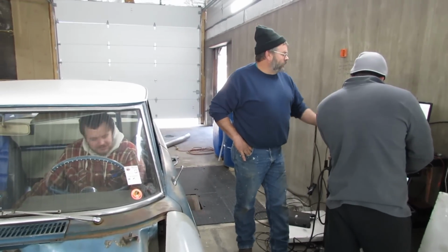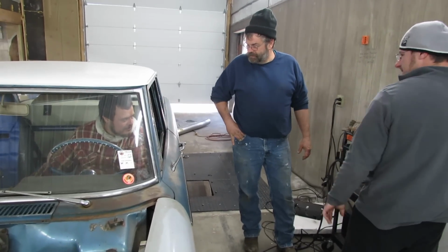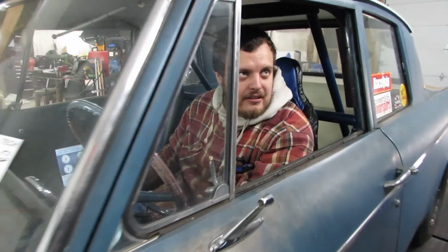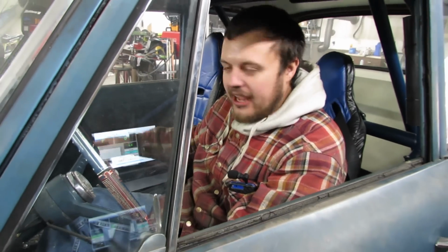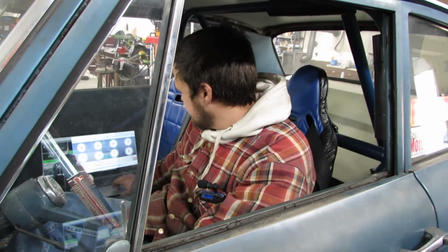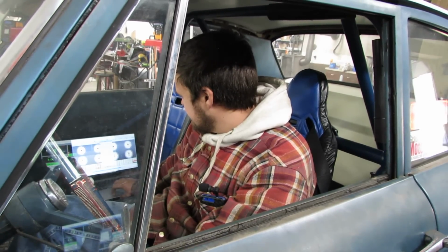All right, so I trimmed some fuel down low out of it. And I'm throwing 23.7. That's the noise you hear. Is that polluted? Yeah, it's too much fuel. The AFR gauge goes 10. Well, actually, not to be argumentative, but it's actually not too much fuel. It's just a lack of spark. Okay, Mr. Methanol.